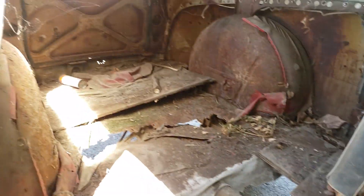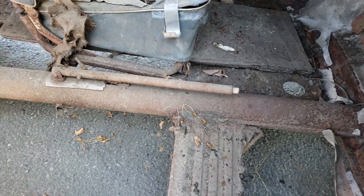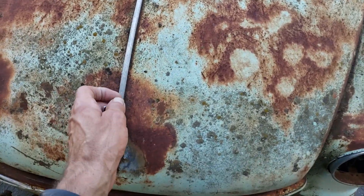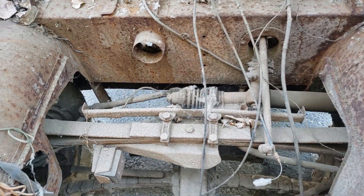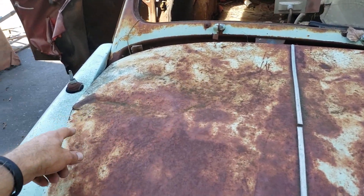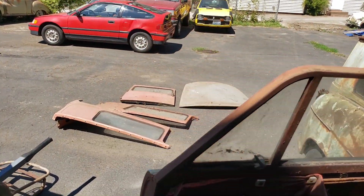It has a plywood floor for the driver's seat, which is perfectly fine. There's a plywood floor in the back for passengers, and no floors here at all. This car is built on a spine — a big main tube that connects the transverse lateral springs in the back and front. This car has no engine, the steering rack is seized, it needs brakes — it needs absolutely everything. So it might be a perfect donor. This hood is really beat up with a huge bend and a tear, but I happen to have a spare hood, though I don't have spare hinges.